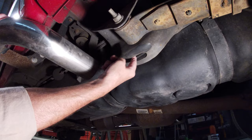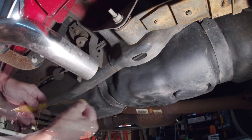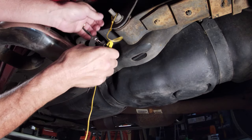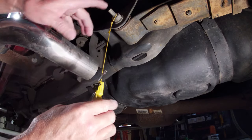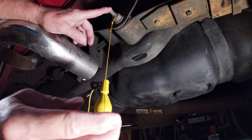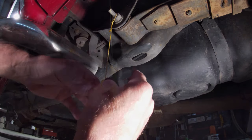On the left rear, I don't like this hole here — it's pretty big. So I have the loop on the end of the string; I'm going to put it on this spring bolt right up against the nut, and we'll use that. That's actually one of the better places you can measure your vehicle. If you're using a computerized 3D measuring system, this is a point that most of them would always use.